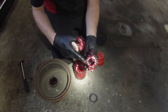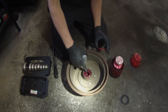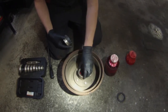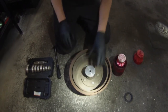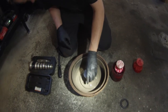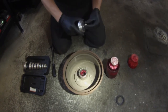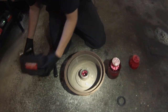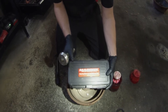There's some nice fresh grease packed in there. Once you have your new bearing or repacked wheel bearing in there, I got a new seal because usually when you pull that seal out you're going to destroy it. I got my seal installer kit here. You don't necessarily have to use a seal installer — you can just lightly tap around it with a hammer to install it. I got one of these kits from Harbor Freight. These are fairly nice seal installer kits.